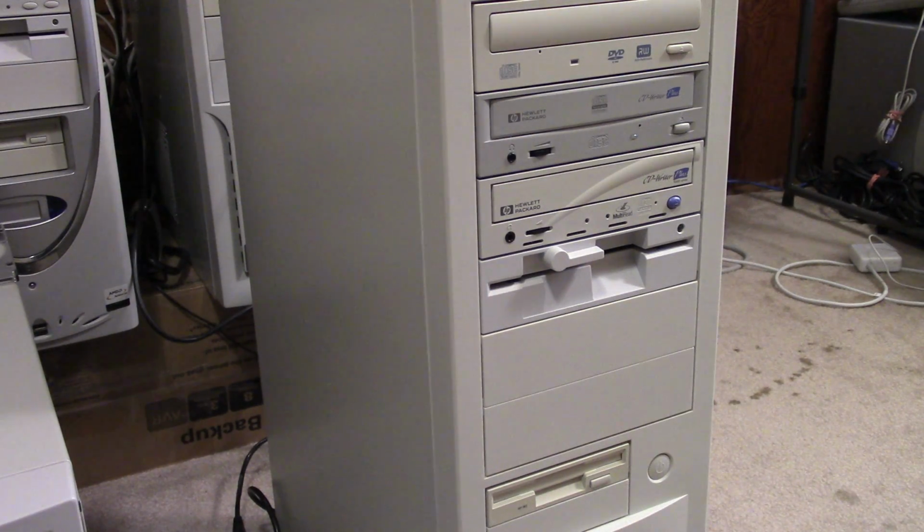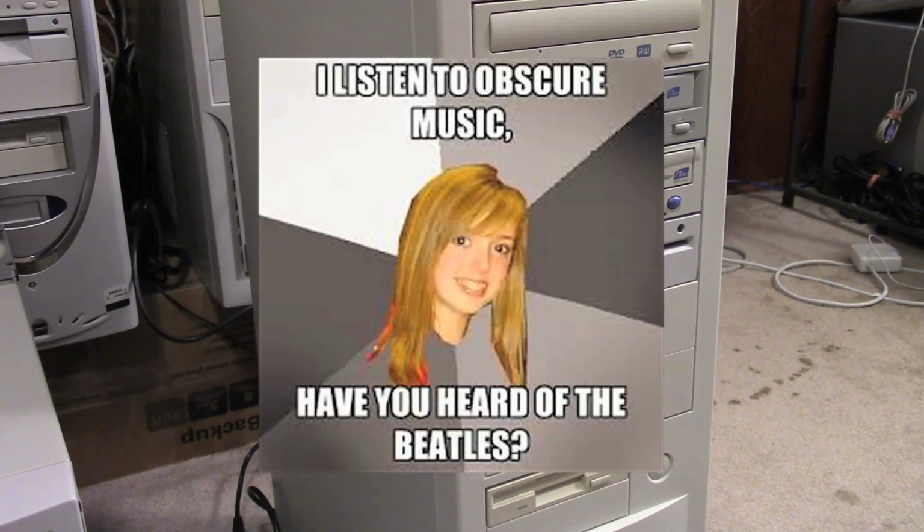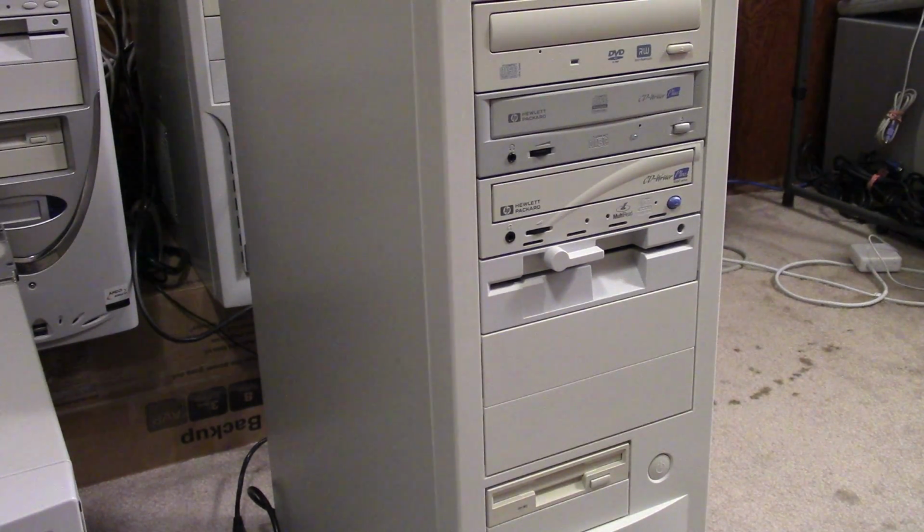The motherboard. This is probably the key thing to really talk about. The hard drive choice is, you can make a minor change here, but the motherboard's the key. The Micronix W6Li or Lightning. This seems to be a little more of an obscure board. I would suggest, if you are planning on building a dual Pentium Pro system, maybe looking more into, I think it's the Intel PR440 FX board. I'm sure someone will correct me in the comments. Something from a bigger manufacturer, something more well known.